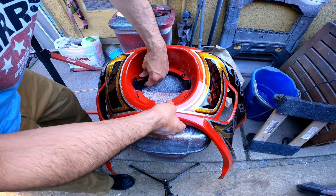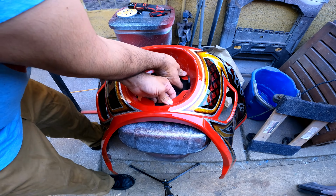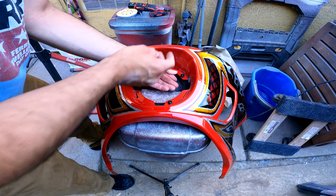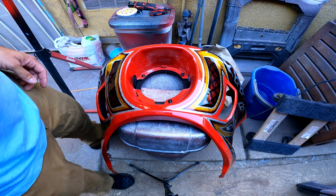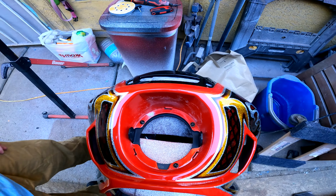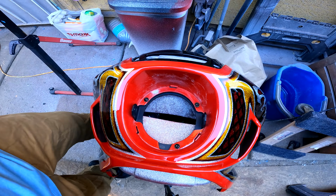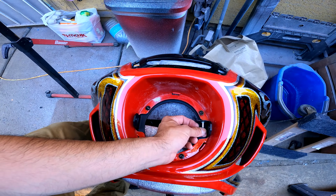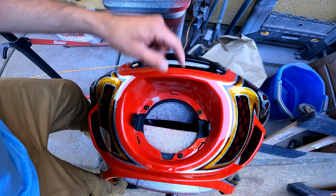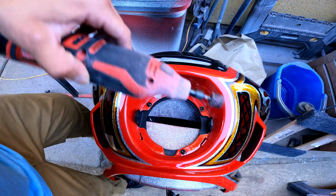Like I mentioned, you'll have to trim this part of the fairing, and that's pretty much it. That's all you have to trim out, is this and this. Oh, the camera, I'm not even sure you should be able to see, because of the angle. So you have to trim this out. All right, I used the Dremel, like I said. I cut into it like this, and then I cleaned it up. You guys can see how nice it looks with, once again, the sanding one.